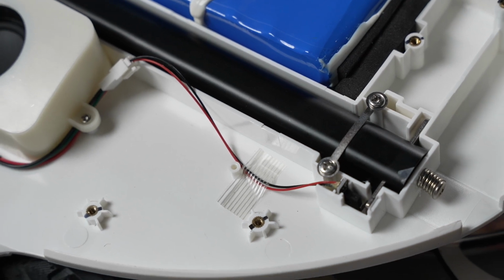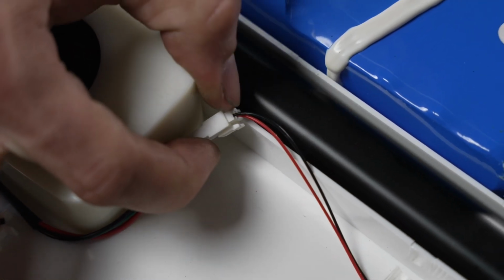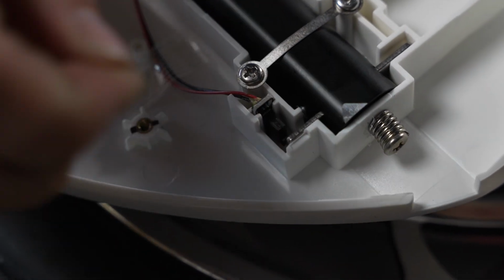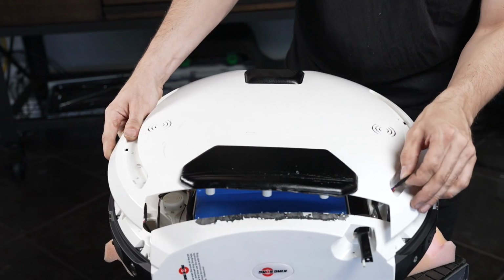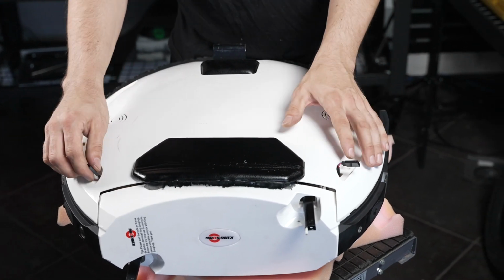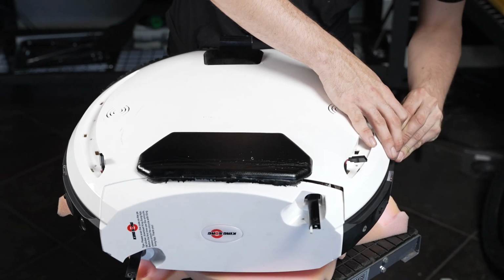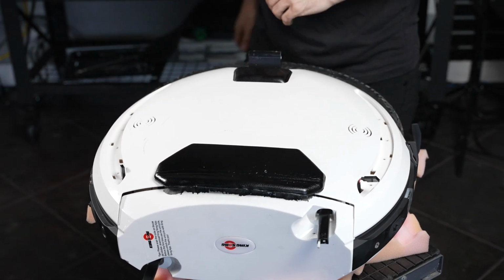Some of you, your lift sensor may be broken and your trolley set should come with a new lift sensor. This is really simple to replace. First, just unplug the lift sensor from its source here, and then pull the lift sensor out of place and put the new one in. Putting this side panel on, again, be sure your LED wires come through. Wiggle it into place. Now go ahead and tighten all your screws in.